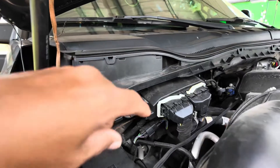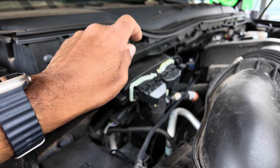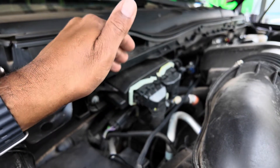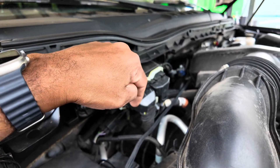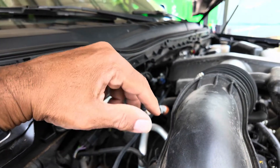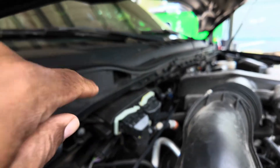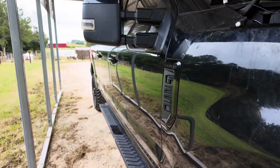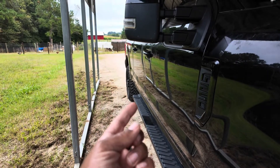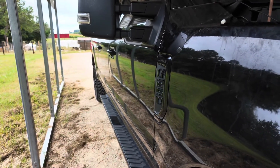Some people will tell you that you want to go through a grommet. Well, grommets are in different places. Here I'm using one that maybe other people wouldn't recommend — a grommet that's under the vehicle as opposed to in the firewall. Different vehicles have different ones for the wires and hoses to pass through from the engine compartment to the cabin of the truck. They're there — the engineers who build this truck are just as interested in getting things from the outside to the inside. Today I'm using a grommet that's under the truck in the footwell. I have used them before in the door well, just under the door. Whichever one you choose, make sure the wires are gathered up and pulled out of the way so they don't get snagged on the road.